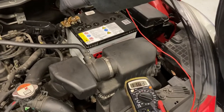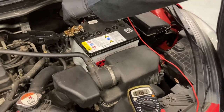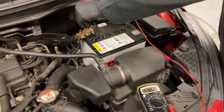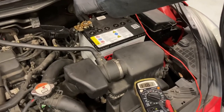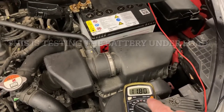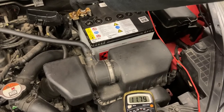As you can see, Courage is checking the voltage and we currently have 11.83 volts, so it's below 12 volts. That's not a good sign and we're already suspecting this battery. What we're going to do now is crank the engine in an attempt to start it and monitor this voltage. If it drops by more than 2 volts — i.e. if it drops to below 10 volts on the display — that would also indicate that the health of the battery is not good.